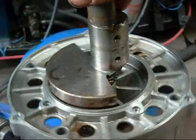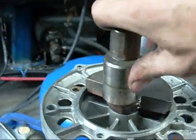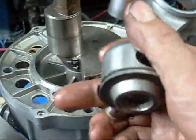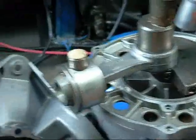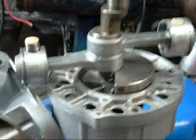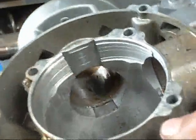In order to turn one of these into a small engine, like a few people have suggested, I think the crankshaft would have to be remade and be 180 degrees off rather than both on the same crank journal. It would be alright as a rotary with heaps of pistons on the same journal, but I don't know how that would work as a normal IC engine. To make it a flat engine, the block casting would have to be bored out and fitted with roller bearings. The bores would handle it though — they're cast iron or steel.